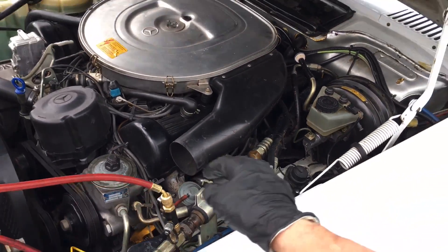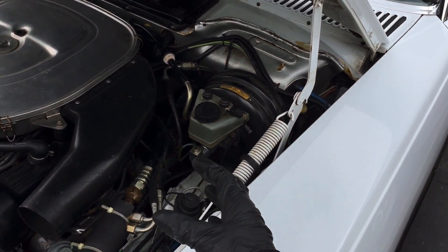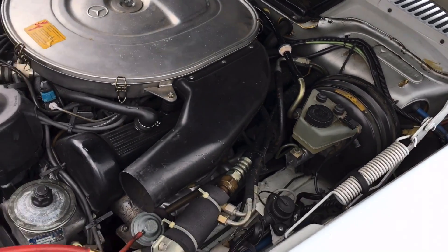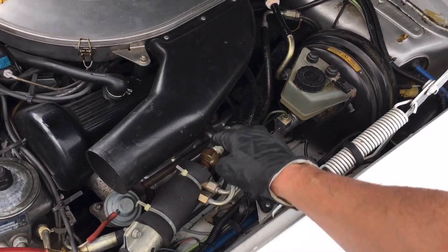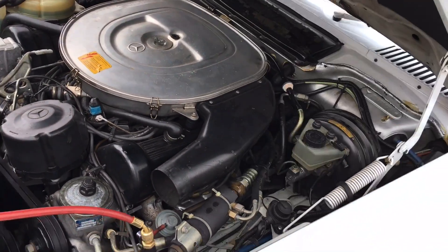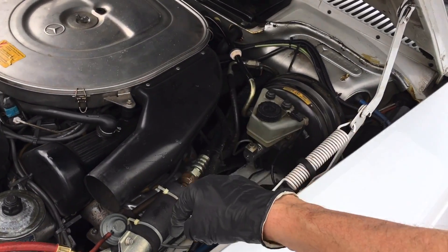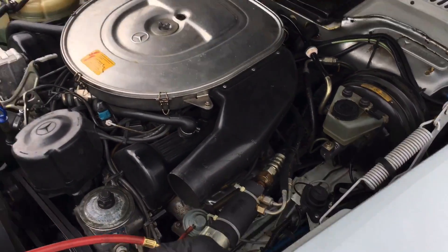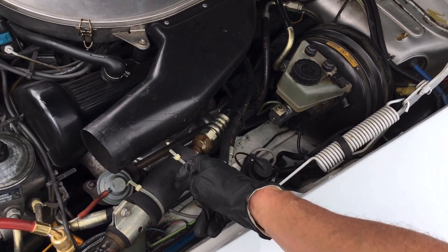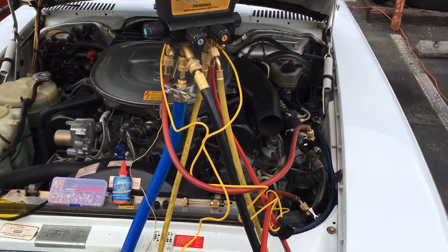So you have added heat to the refrigerant. This means if somebody has a fuel injection drivability problem — say they're in Los Angeles at 110 degrees, stop and go, under-hood temperatures exceeding 200 degrees — and they have a dead or low AC system, you have no sub-cooling left over. You're delivering warm 90-degree vapor to the cooling side and it's not getting cooled. You develop drivability problems. This heat exchanger was there to get rid of those problems. But if you allow the AC to be undercharged, you hinder the fuel delivery system because it's incorporated inside here.